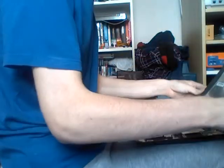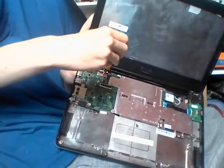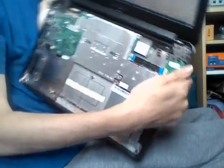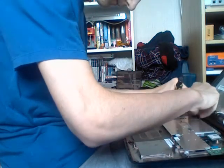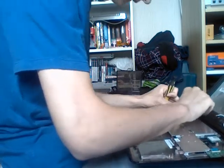To remove the display assembly, you need to remove the screen. You'll need to remove the LVDS cable and the WiFi antenna cables. Pull up on the little WiFi antennas and de-wrap them from the case. For the display cable, pull up, peel the tape off the top, slowly grab the two connectors and pull them back. Then de-wrap this cable also.